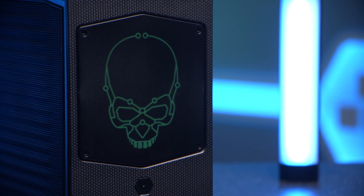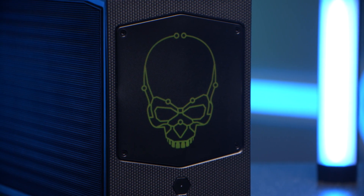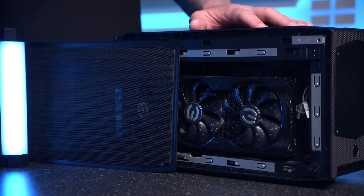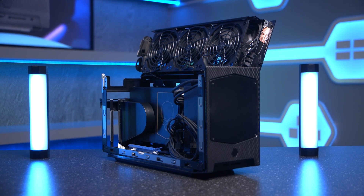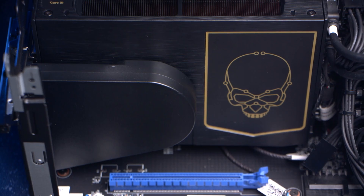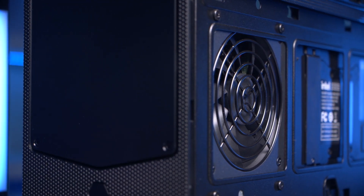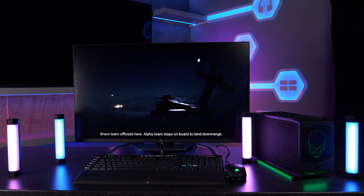Lastly there's a card reader and a 3.5 millimeter headphone jack. It's a serious amount of connectivity considering the compact size, and you also get interchangeable face plates with either a plain or skull design. We're going for the skull design today as this is for gaming. To keep everything cool, Intel has been pretty smart with the cooling — a mesh side panel feeds cool air to the GPU, exhausting out of the top via a triple fan setup. The CPU is cooled with its own dedicated centrifugal fan taking air from the rear of the case, and the PSU also has its intake on the right side. This does mean you need to think about placement so you aren't blocking any airflow — basically just make sure there's a bit of space all around it.